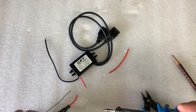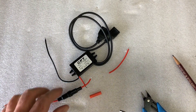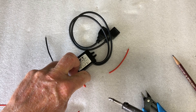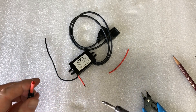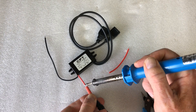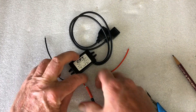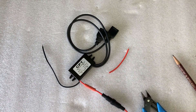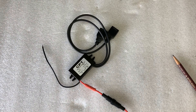The wire is nicely tinned. I have some red heat shrink and I'll just put that on here. It's just a little bit too long, so let me adjust. That's all I need. Soldered very nicely, and then that's going to be slipped over and then we'll shrink the heat shrink down. And then we have our inline fuse installed.